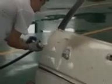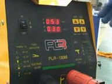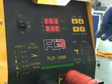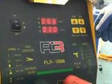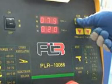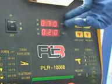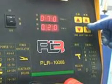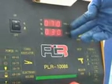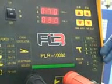After installing the hammer, put the clamp to the vicinity of the welding part. Now, turn on the power switch and set the welding data. Recommended power is 70% and time is 0.3 seconds. The recommended power and time data is on the operation panel.